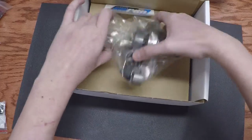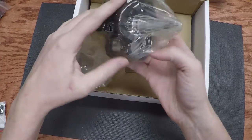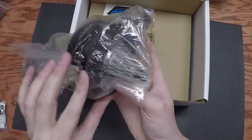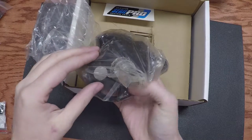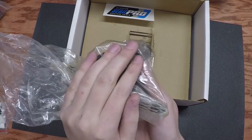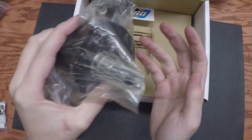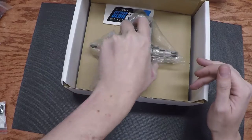This is a Mazzucchelli crankshaft. It's already balanced and it's flowed. You can see here that it's kind of ported/flowed, which increases your flow from your intake into your cylinder port. Very well balanced. Why this crankshaft? Because it has a 60mm stroke — so we're getting 3mm more stroke. With the cylinder I'm about to show you, that will get us to about 187cc. This, along with the bearings, is going to go into the freezer overnight.